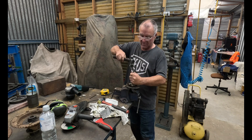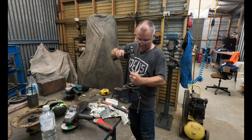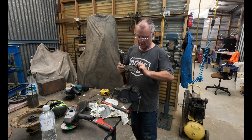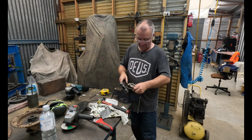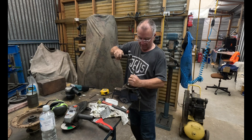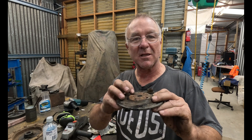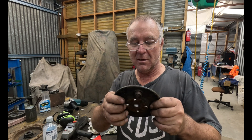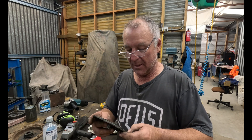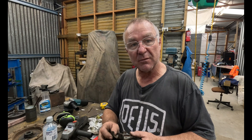I've just ground the heads off the rivets and I'm just driving them through now. It certainly doesn't want to come out. We've got it off. Interestingly enough, the size of the diameter of the rivets — they're like nearly 5/16 diameter. Like, they really meant that to stay on, which is good. I mean, it's for a brake. So I will just give this a little bit of a clean up and I'll use this as a template to start making the bracket for the new setup on the fork leg.